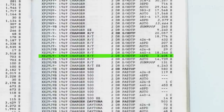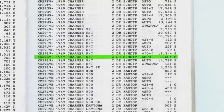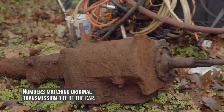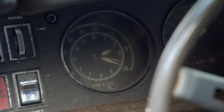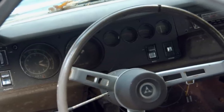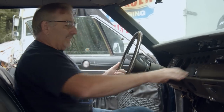This little Charger is a real-life XS29L car — that means it's an RT and a 440 Magnum. It's a D21, which is the call-out for the four-speed. You got the numbers transmission, but it has a busted ear on it. It's actually a pretty well-optioned little car. It has the N85 factory tachometer — it is a tach car. The car is coded for an R11, which is AM only radio, so I'll put one of those back in it and keep the factory AM/FM for someone who has that option.